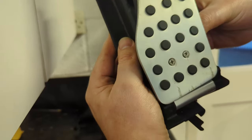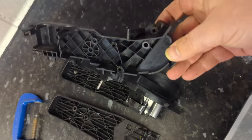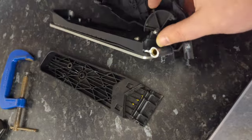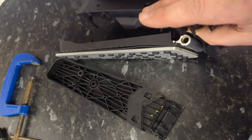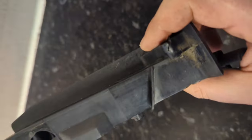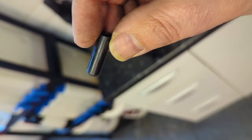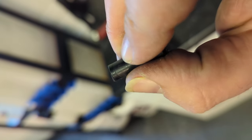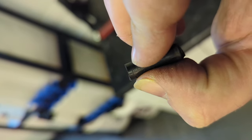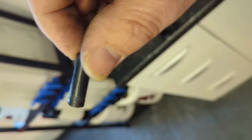So then I took it all apart, and of course, as I'm taking it apart, this piece here is absolutely wedged into here, dug in like an Alabama tick. And then I snap it, trying to get it off. There, you can see the foot there, snapped. Snapendo. There it is, look. Here's the peg that snapped. And if you look carefully, you can see how it's distorted, where the brass bar has slid all the way up to that last bit and then got seized and jammed. It's almost pushed the plastic up as well. So it just couldn't quite sleeve on here.